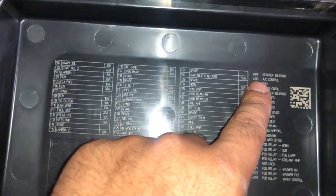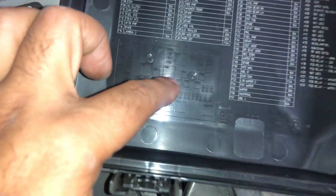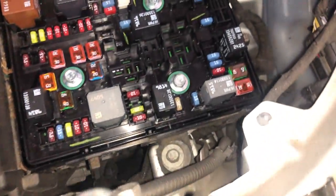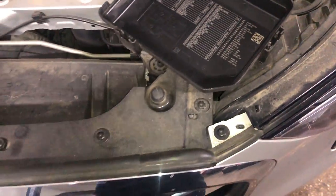That's a relay K2. So if you look at this right here, this is the relay for your AC controls. K2 would be right here — it's right next to F4, which is right here. So those are the two things you want to check.